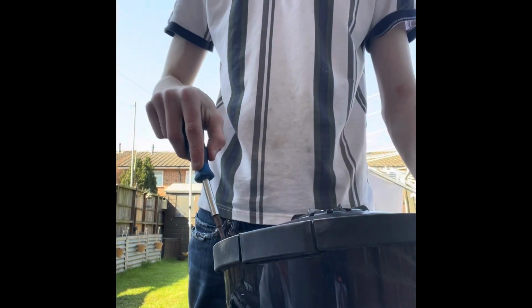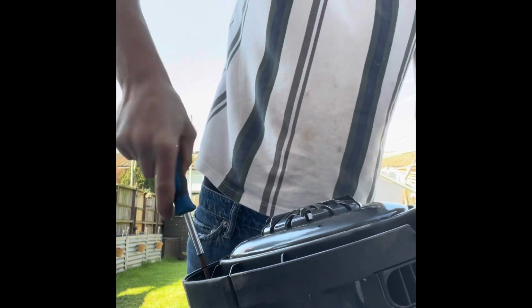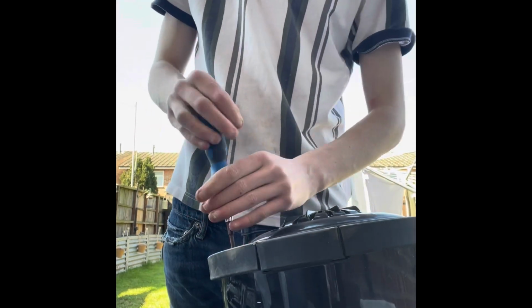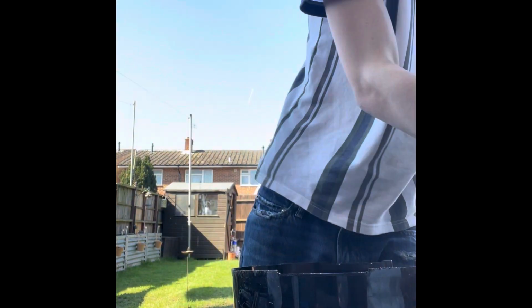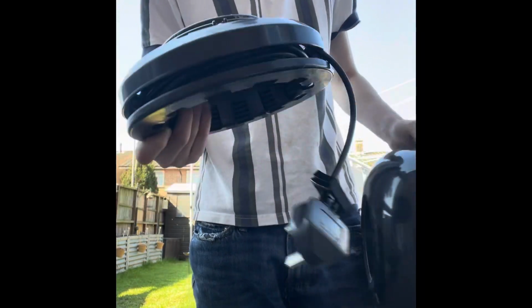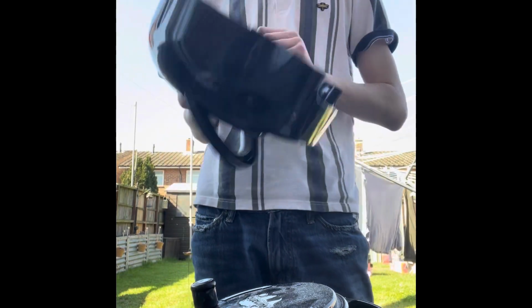Just had to go get a different screwdriver because one of these was already cross-threaded. So if you just take the 4th screw out, get a little flathead if it gets stuck, and just pull it up slowly. You've got your 4th one out, pull that up, and then you'll be presented with this, which is the cord reel, and you'll be presented with the top. You don't need to take anything off the top. You clean that hole.